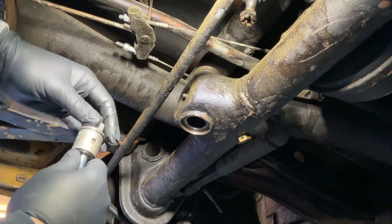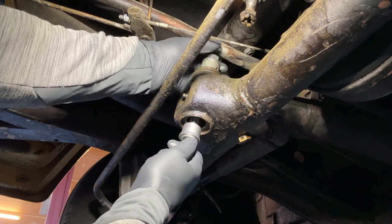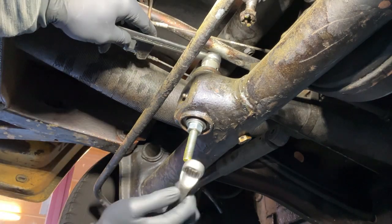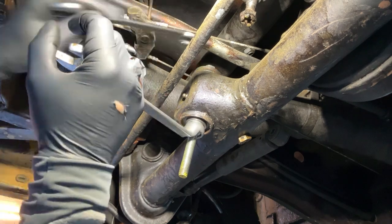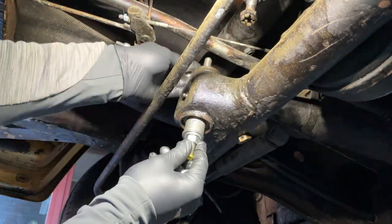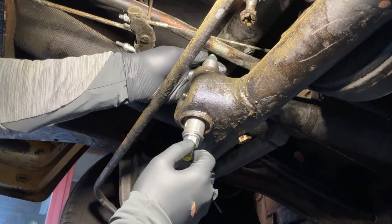After having prepared the housing for the new bushings, I set up the tool the way I can press in the top bushing first. This is absolutely a simple task. Afterwards, there's no issue. It is perfectly aligned and goes in like butter. The other way around, bottom bushing, which is turned at 180 degrees, and do the same thing again.